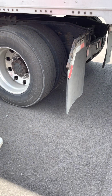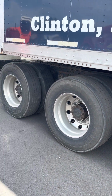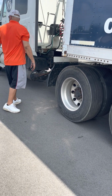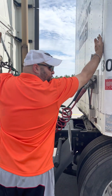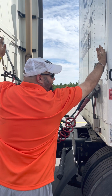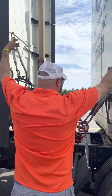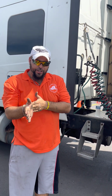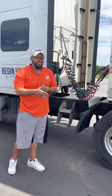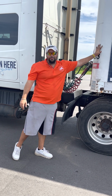All right, so now I've knocked out my whole truck. Now I just gotta worry about my trailer. So here, we got outage in two spots. You gotta call the outages here. Got my outage here between my trailer and my tractor. Outage is enough space to turn without making contact. I can turn to the left or to the right without my tractor hitting my trailer.